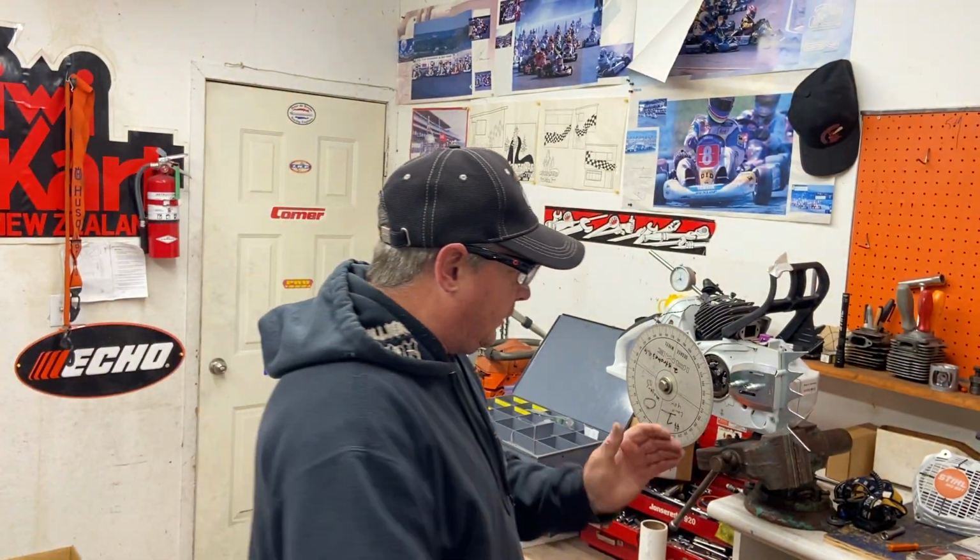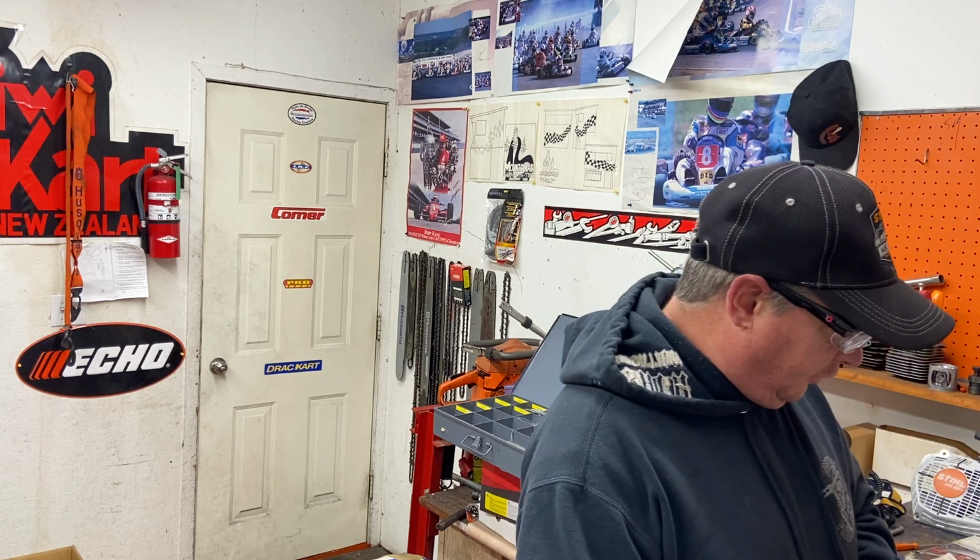All right, well, that's it. Oh, and I got some new dogs today, or yesterday, from Gordy at West Coast Saw. Thank you very much, Gordy. Some new sample ones to try on the 7310 Echo. He had already sent me some that he already made, some 3.1s. But I found the fallers found in the bigger wood, trying to use the pivot point of the dog to get their undercut, bottom of the undercut done. That little longer of the spike on the bottom, half-inch more down should be better, like their other ones they use on their 390 Huskies. So I had him make them that way, half-inch more down, and I'll show you that later on at the shop when I put them onto my demo Echo 7310.